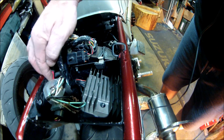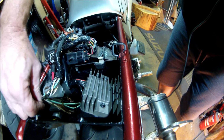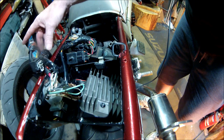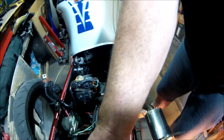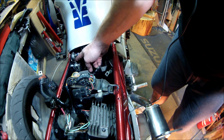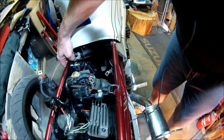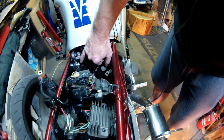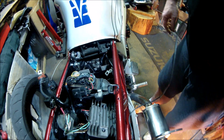And the starter solenoid is nearly bolted in. Well, it's bolted in, it's just not tightened up. The lock's in, which you can't see because of this in the way. Lock's in. I had to bend the clip a lot more than it wanted to be bent to hold it in there, but that's in nice and secure. So I've just got to set up the lock and everything and bracket to go across here after I've tightened these bolts in to actually hold the subframe on.